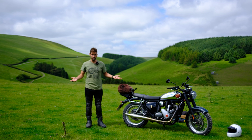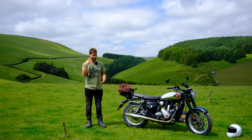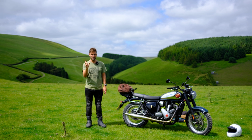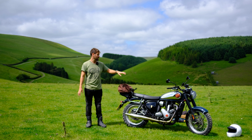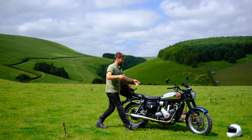So I thought, right, you know what? I'll ring RNG up. I rang up RNG, and this is a little lesson for everyone. If you ever get stuck, don't be afraid to go back to the original manufacturer, the big company. I was literally on the phone to RNG, having a little chat with this guy, and he was like, oh, we'll get you sorted, really down to earth. And so he, free of charge, sent 110 millimeter M10 bolts with the correct pitch to go in there, off another kit for a different bike or whatever. So now I've got 110 millimeter bolts, 45 millimeter spacers, and Bob's your uncle.